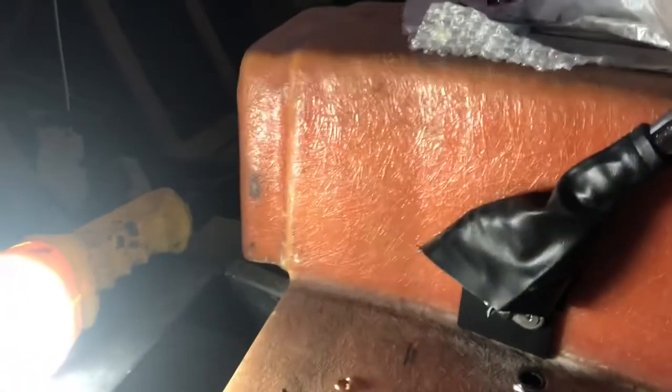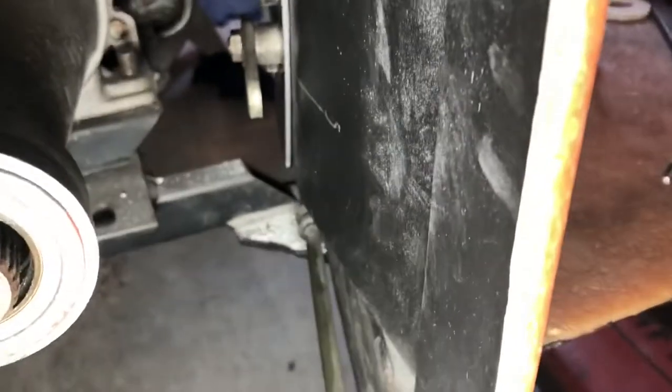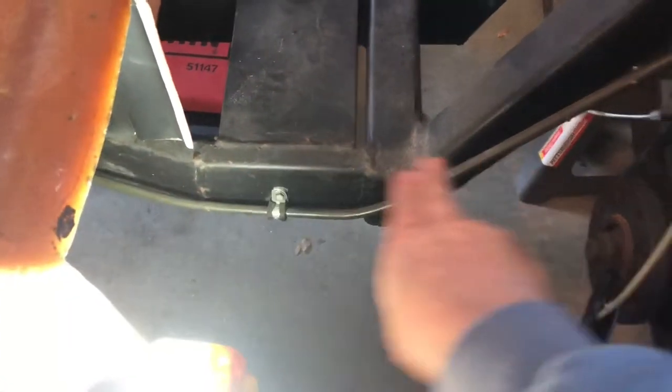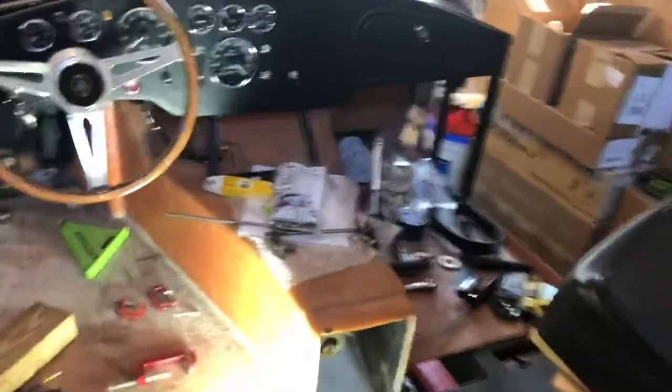I do have the cam mounted in there — you can see it down in there. Pull the lever forward and the cam swings one way; pull it back toward the rear of the car and the cam swings toward the front. The cables are going to have a little mount in here, and a guide mounted on the driveshaft safety loop for a nice short straight pull. I wish I'd done it this way in the first place. Even with all this mess, it looks exactly like an AC Cobra handbrake should.